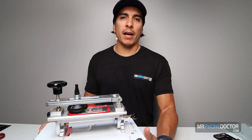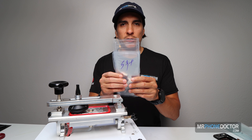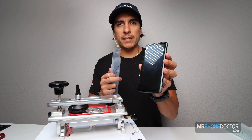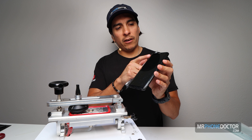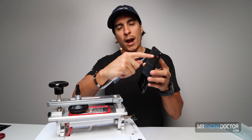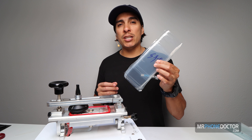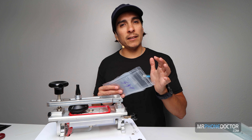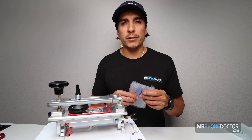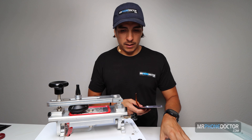As I mentioned, the parts I was waiting for were these clear glass sheets. What these clear glass sheets do is they sit over your OLED panel, over your old broken glass, and they create another thicker layer. That way, when you start lifting and separating, you don't have all these cracks bending and incurring damage on the OLED. They make these for each series since the radius on the glass is a little different per model. This one's an S9 Plus, but I'm almost certain it'll work on the S8 Plus as well. Let me show you guys our display we'll be running for training purposes.